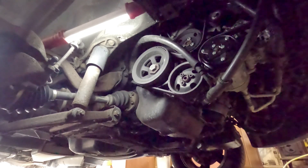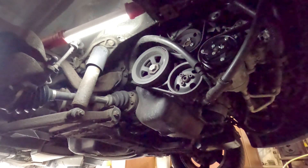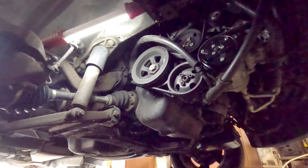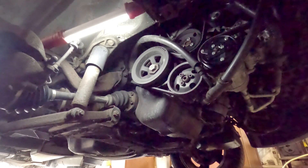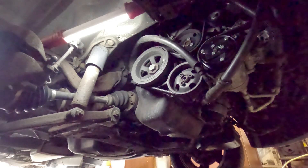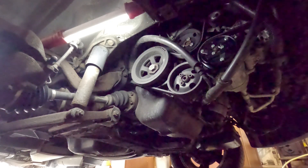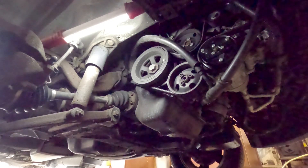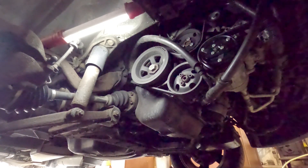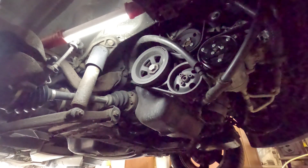As you can see, the compressor is now kicking on and working properly. I'm going to button this all back up — that should take care of the problem. The bearing noise is gone, that was definitely the issue. We got all the new components, I have a new compressor put aside in case this one fails, but this one is working properly now. If you have a similar issue, you can replace just the clutches without having to replace the whole compressor and deal with evacuating and recharging. Hope that helps — give a thumbs up, a share, and subscribe if you haven't, and I'll catch you on the next one.